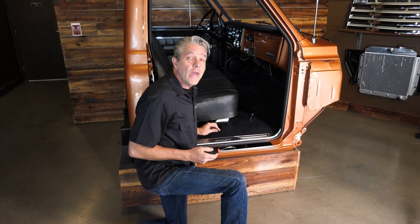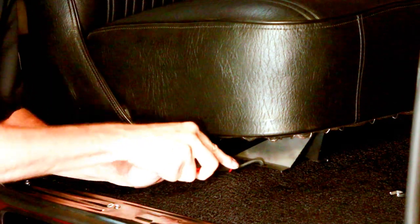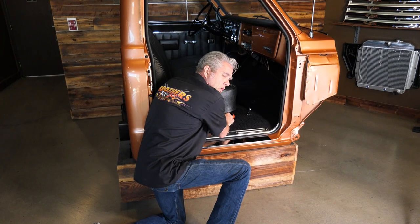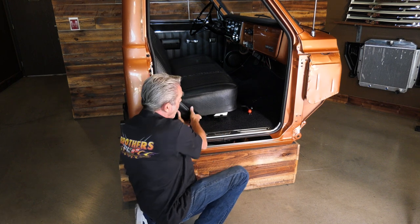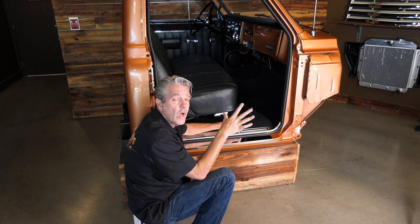With the seat back in the cab, I'm going to go ahead and look for the holes in the floor. A nice little trick is you get a little pokey tool like this and keep poking around until you find the hole. Go ahead and get one bolt in there and just put it down about four or five turns, because you're going to need to find each one of the bolt holes. After you get all the bolts in there, don't tighten it up — leave them a little bit loose because we're going to move this forward or back to get it as comfortable as possible, then tighten everything down.